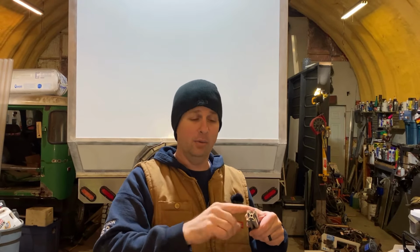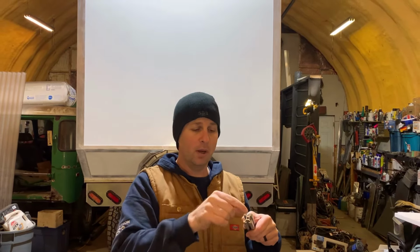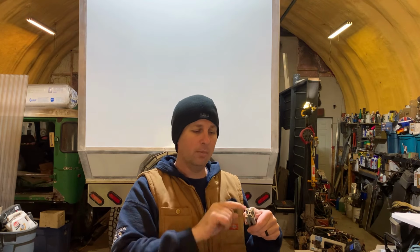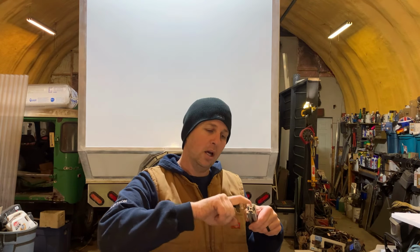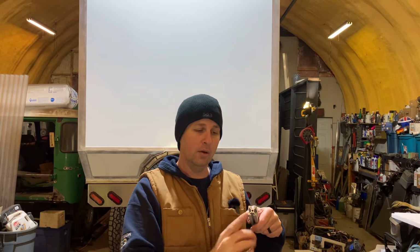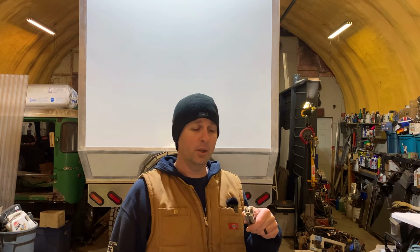Now, with that, I also want water to be able to get out, again, because the aluminum wraps around the end of the roof, the water can't escape out the end. So by removing this inboard section here on both ends and this section here at the bottom, any water that gets caught in the upper track can run out, and any water that gets caught in the lower track can run out. The bottom track will be sealed and the outboard track will be sealed, so I don't have to worry about them, but I do need to remove some of this so that I can get nuts in and water can get out.